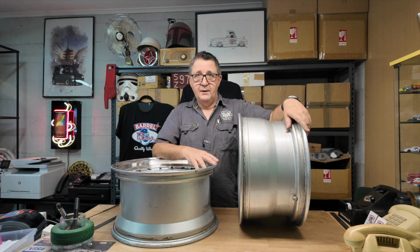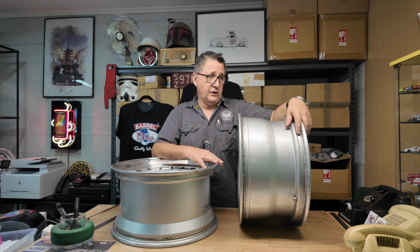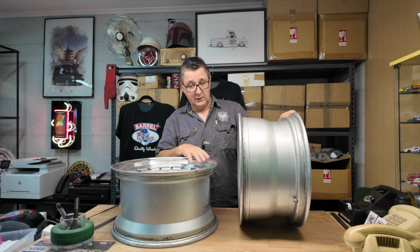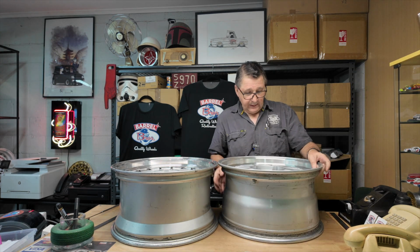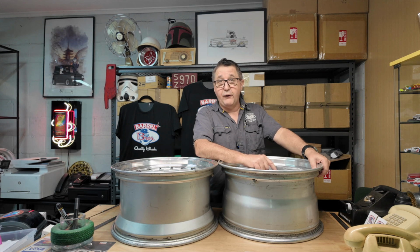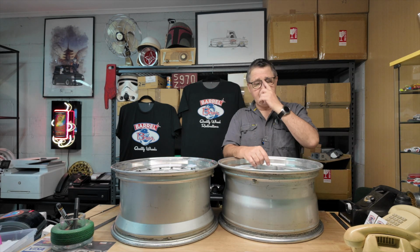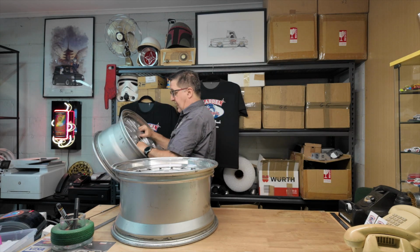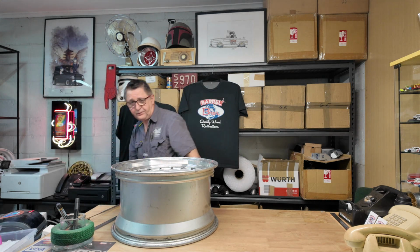So you've got a 9-inch wide wheel, not a 9J. I've got 9 Js, I've got 10 Js, I've got 10 JJs. These are actually JJs because there's 2 Js on it, right? Nothing to do with the radio station. Okay, 9 by 17 ET35, or plus 35 in this case. ET, I don't know what the ET actually stands for, doesn't matter. So that's what the size is, and because it's a BBS, we know it's exactly that. I don't even have to measure it.